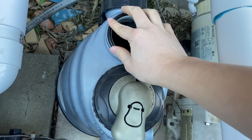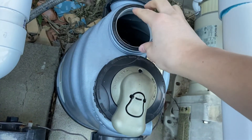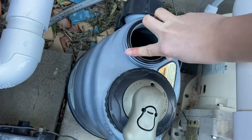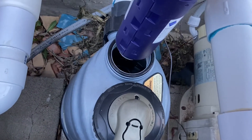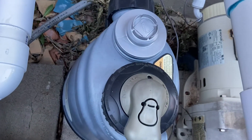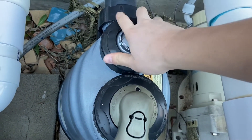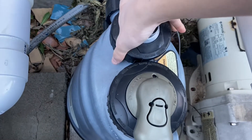We'll put the o-ring back in its place — it does sit in one direction so you may have to flip it if it's not sitting flush. Then just turn it slightly so the lube gets in there and into the crevices. After that, drop the cartridge into the slot here and turn it just to get the lube on it as well. Then put the lid back on top, turn it clockwise, and it should be all properly done.